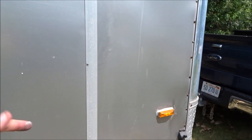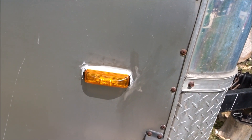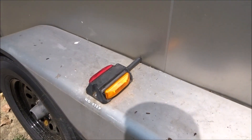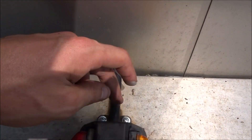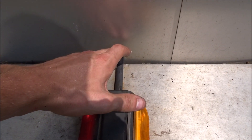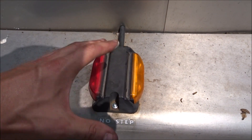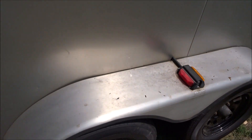So I just finished up with all the lights. Let me go around and show you what I've done. This one just had a loose screw, so I replaced both screws and the light because I wanted LEDs for the main markers. For the side ones on the fenders — you can see the light there and there. This one, I replaced all three screws, but also the ground underneath was corroded and the wires hooking up to the main hot wire were also corroded. So I redid the connections, cleaned it all up, made sure it had a good connection. These lights worked — I did not replace these.